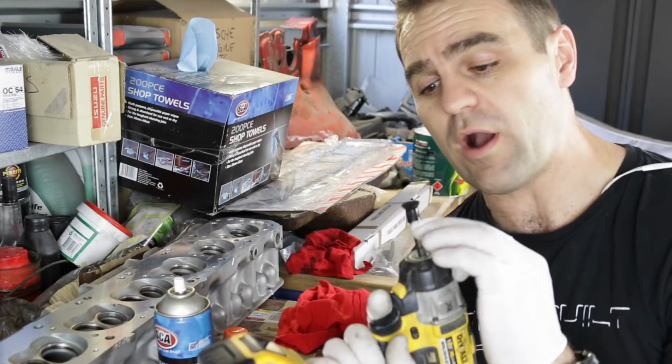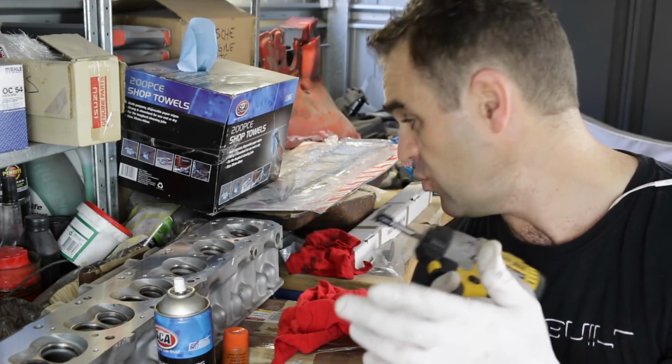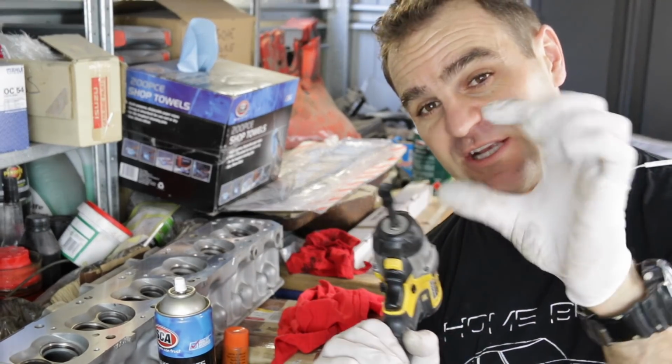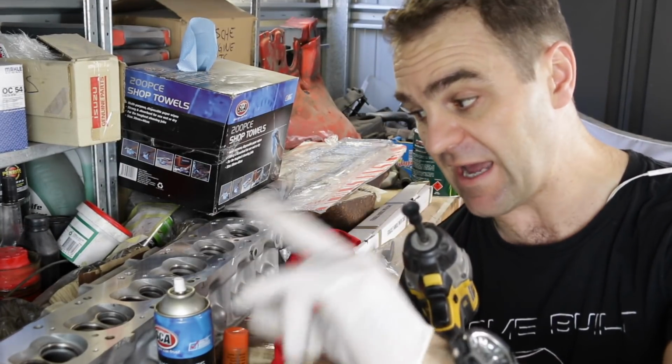Alright, that worked quite well. So there's at least 2 valves here that I have to replace. There's that 1 inlet valve, which I just put in again to play it in, and you can actually see it wobble. So you can see that the valve is bent. So that valve needs to be replaced, and at least one of the exhaust valves.